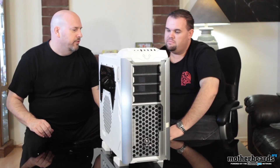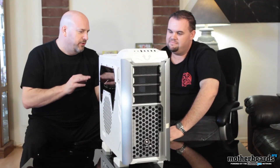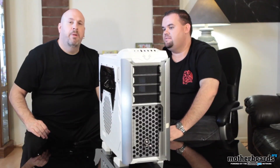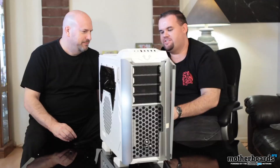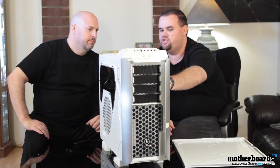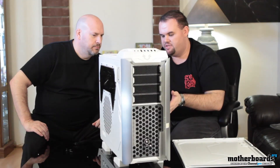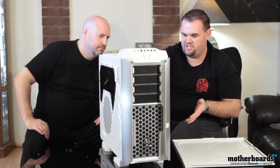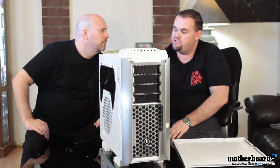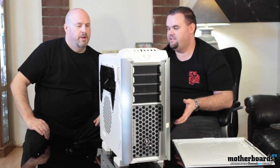What about Rodney Reynolds? Is Rodney Reynolds going to be disappointed with this case? Is this a removable motherboard tray? It is not a removable motherboard tray. We apologize to you, Rodney. Well, that's something you'll see — there's not a lot of removable motherboard trays anymore, because when it comes to cable routing to the front, you're tying everything up. So if you remove the motherboard tray and you have all your drives here, you've got to be able to move those cables, and if you have your cables routed through these large pockets for cable management, you're going to have some serious issues there.